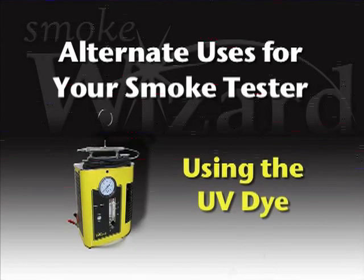We had a lot of leaks, and it became difficult to get the camera in there to see the injector leak. That's where the ultra trace UV dye comes in. Let's go ahead and put on our glasses, get our blacklight out, and look at that ultra trace UV dye. As you can see here, the injector — right where it enters the bottom of the lower intake — is leaking vacuum. We've got a vacuum leak there.